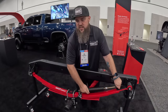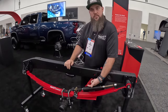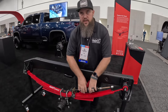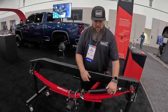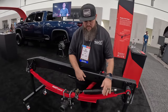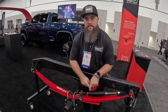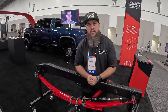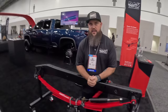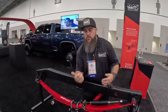It'll take you maybe 30 to 45 minutes on some jack stands, maybe 20 minutes with a lift. What's happening is the threaded rod is being drawn down into the coil spring, and the spring starts to open up. Once you get there, lock the lock nuts in place — that's the whole installation. Put the wheels back on the ground, the leaf spring comes back up, and that gap you set is forced to open. It's basically a glorified slinky — you stretch it and it wants to come back together, which forces the wheel down, giving you traction 24/7 with or without a load.